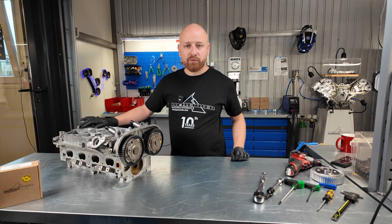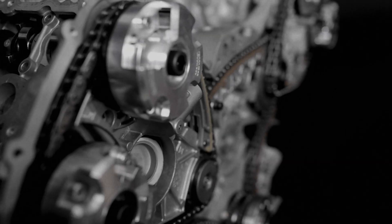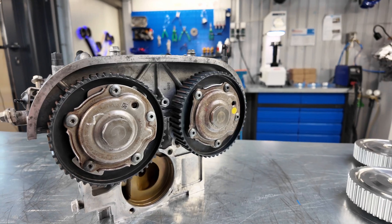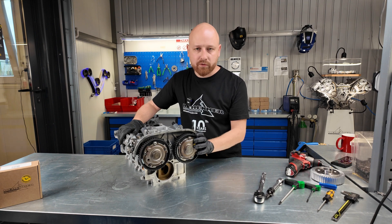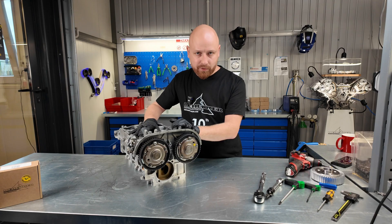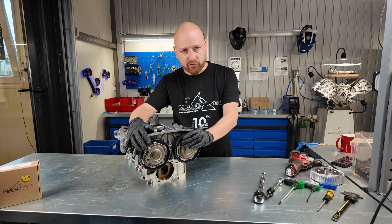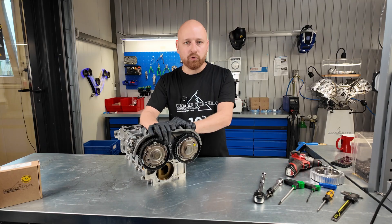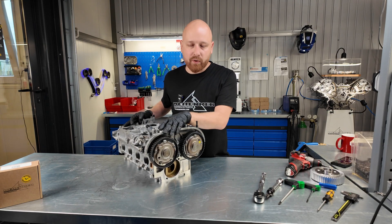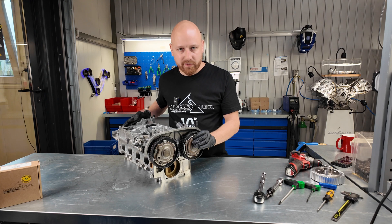Now let's take a deeper dive into discussing the construction, working principle, and typical faults often linked to the camshaft phasers in this specific engine design. This is what a typical cylinder head for the 1.75 TBI engine looks like. Here we have two camshaft phasers. The intake phaser operates within a range of 30 degrees in total, while the exhaust phaser functions within a total range of 25 degrees. In the vast majority of cases, the cam phasers remain firmly locked in their default positions and stay entirely stationary during engine startup as well as throughout idle speed operation. Only when there is a need for increased torque or power output do the phasers start to engage and make the necessary adjustments. The standard position for the intake cam is determined when the shaft consistently remains in a retarded state. Similarly, the standard position for the exhaust cam is confirmed when the shaft consistently stays in an advanced state.